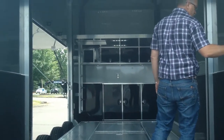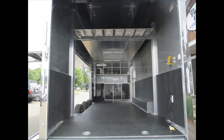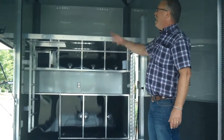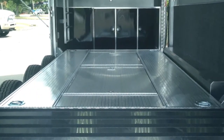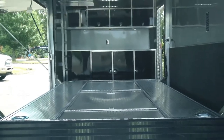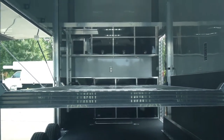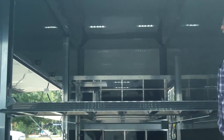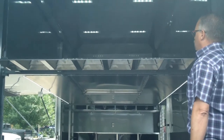The other thing about this lift is that all our hydraulics are up high in the lift. By having the hydraulics up high, that's what's allowing us to get the lower profile. Most lifts have the hydraulics incorporated into the lift itself, and that's where they need that extra two and a half inches. Ours are all up above. In the sidewall, the locks are almost infinitely adjustable as far as the number of positions you can stop the lift at.